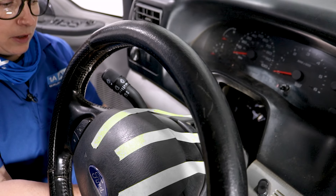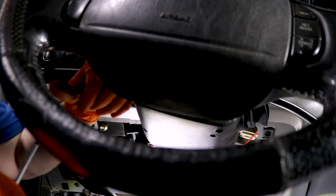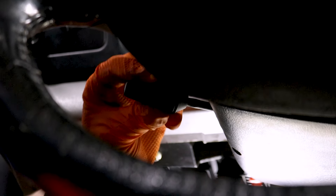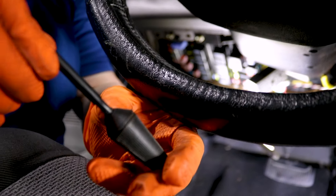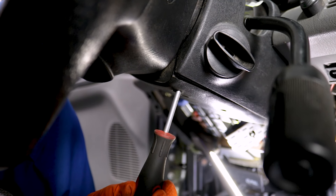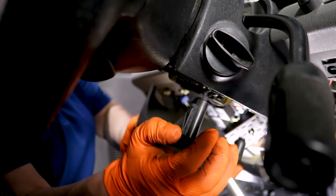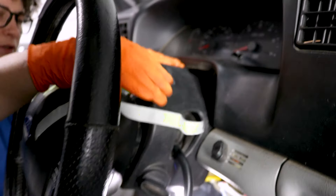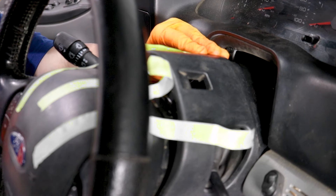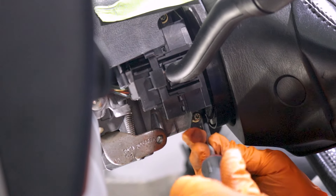Now that it's all dropped down, wait until you see how easy this plastic column cover comes off. Phillips screwdriver. We do have a tilt steering wheel — if you have a tilt, just grab it firmly counterclockwise and spin it out of the way. If you don't, there's a little notch on there that Ford was kind enough to put in; you can use an adjustable pair of pliers on it and break it free. There are three Phillips screws total.